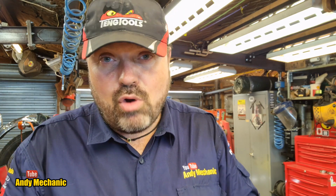I'm hoping, absolutely hoping, that it fires up on all 4 cylinders, because the original customer complaint was very poor starting, and we checked the bike and it had weak spark. And number 2 cylinder was down a little bit on compression as well, which meant it was even less likely to start than the rest of them. And on a cold, wet day, didn't want to know. It only sort of came into life after maybe 30 seconds or a minute of running, which is no good to anybody, is it? The bike should start on all 4 cylinders. So by having a nice, crisp, strong spark during crank on cold start, number 2 cylinder hopefully will fire up.